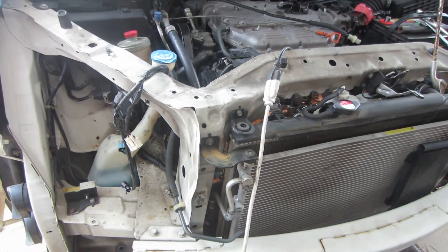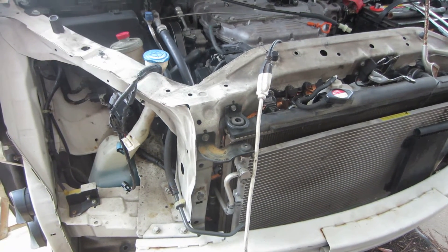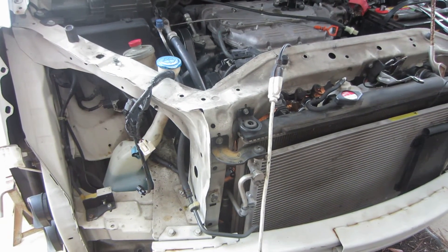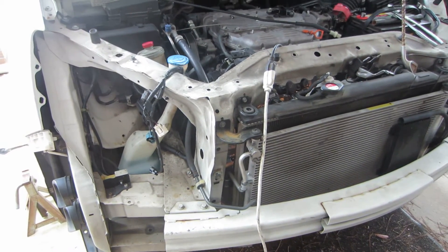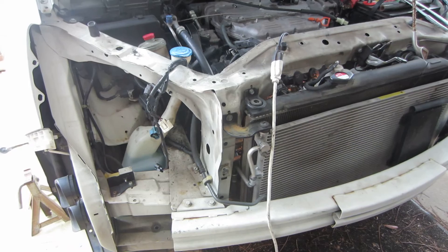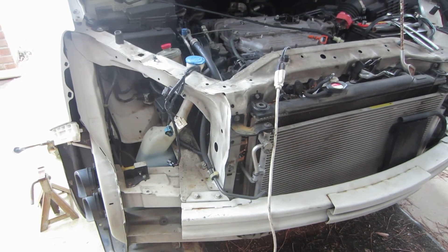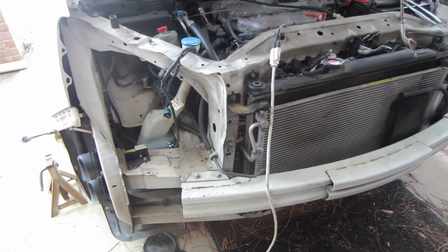You don't have to take the front bumper cover and the headlight off, but I think I would do it anytime I change out a Honda Odyssey alternator. Another point: the alternator went out because the VVT valve gasket went bad and leaked hot dirty oil down onto the alternator, which ruined it. The new alternator package warns against this and says it's cheaper to replace a VVT gasket than to replace the gasket and alternator later. I've got the VVT gasket replacement in another video on YouTube.